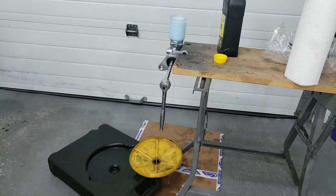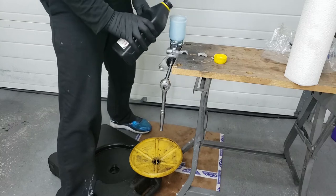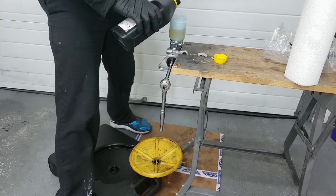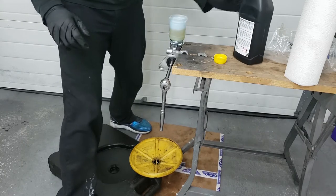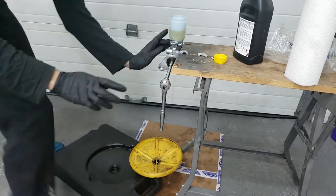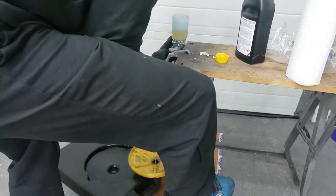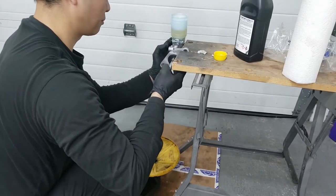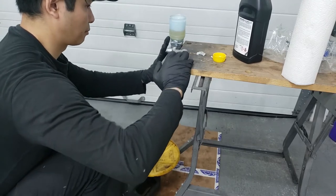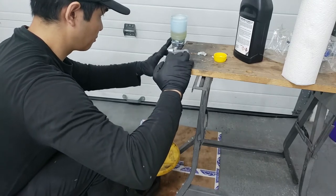Make sure your tray is under, because you're gonna be getting brake fluid everywhere. This is the messy method, because I don't have a master cylinder bleeder kit. All right, so some brake fluid. And what you would do is you have to hold your fingers in here and wait until the fluid actually comes right out. So I gotta really hold this down. So the method here is that you'd pump the piston with your fingers hovering over the brake line holes and then plug the holes with your fingers when you release the piston. Keep doing this until the fluid leaks out from both holes.